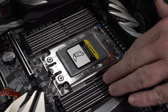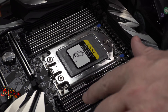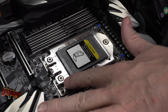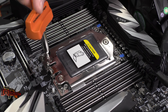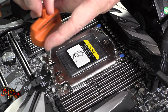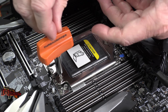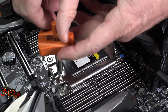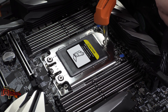So this is a look at our TR4 socket on the motherboard. You'll see we've got exposed screw fasteners — there are three of them, labeled one, two, and three. To open this up, we take our tool, insert it, and turn it backwards until you hear it kind of click, which means it's out of that thread. We do the same thing on the second one.